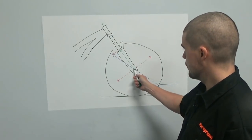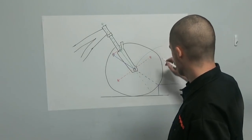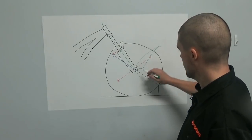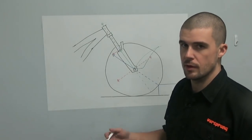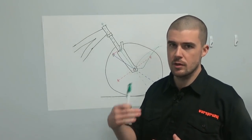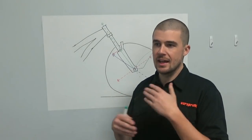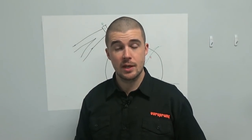The more delayed the response, the closer the axle gets to the bump before it starts moving, meaning instead of arcing smoothly up and over, it has to rush up to get over the bump in much less time. That compresses the tire more, transmitting more force through to the suspension — both coaxially and perpendicular to the suspension motion — driving up peak velocities and peak damping forces, adding to that harsh, hanging-up feeling. The point is to understand the mechanism by which low speed damping can negatively impact bump compliance. Low speed damping is not inherently bad, but above a certain point it is. That's enough for this week — thanks for watching.